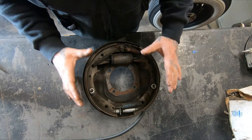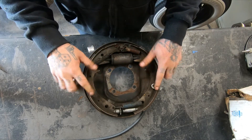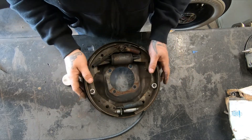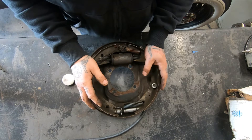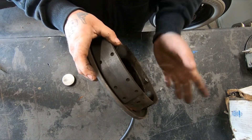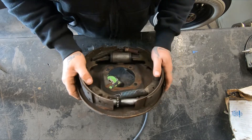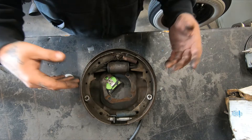These are typical drum brakes — this is a front drum brake setup. You have your brake shoes, your adjuster, wheel cylinder, plungers, and your hold-down springs in a couple different locations. This holds the shoes to the backing plate, and you also have a pin at the top that these pivot on. When you apply pressure with the brake, it puts fluid in the wheel cylinder, pushes the plungers out, and applies the shoes to the side. They don't dissipate heat as well and don't have as good stopping power as disc brakes. Pay attention to the shoe material: there's riveted, like these, and there's bonded — bonded shoes don't have the holes where the rivets go through. The shoe material is shorter on one side; that's the front shoe, which goes toward the front of the vehicle. These do work pretty well and they're not unsafe, but if they get too much water in them or aren't adjusted properly, you won't have good brakes.